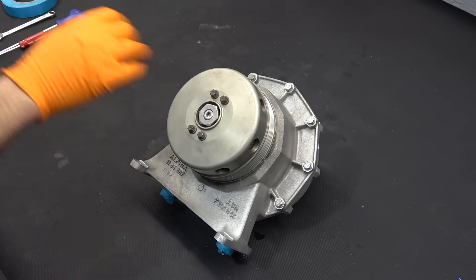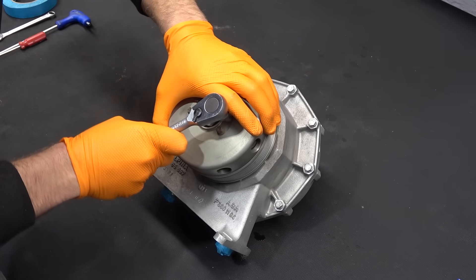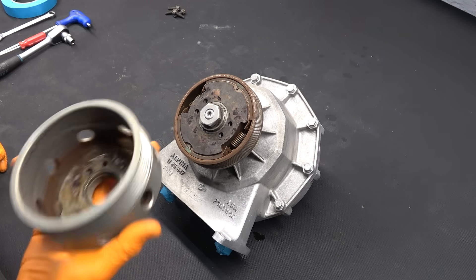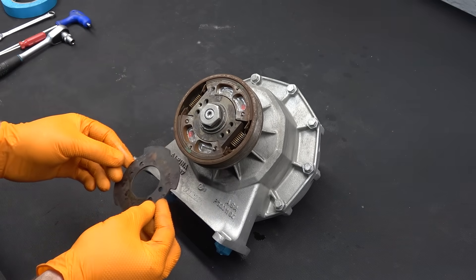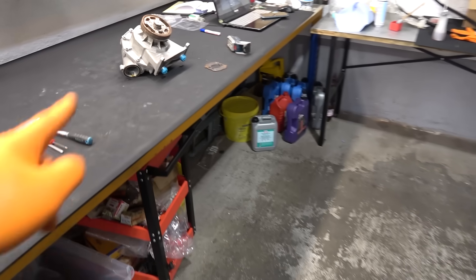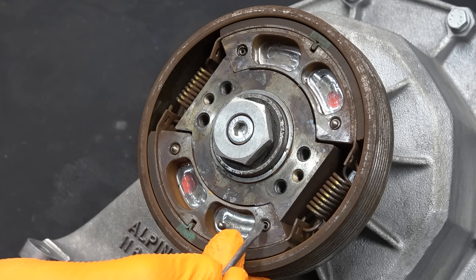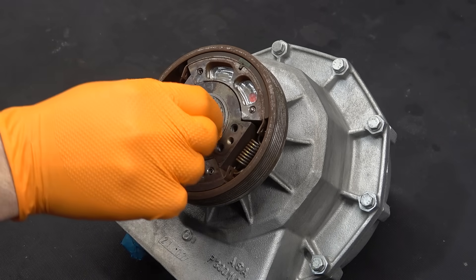The clutch assembly leaves behind this pulley, so we've got to remove that first. The clutch friction pads look good — smells like it but looks good. Remove the plate. There were balls in there — one just left the building! There are four balls with springs behind them, and on two of them the retaining clip snapped, which is why they fell out. I just need to be careful putting it all back together. Now I'm going to remove the bolt and the big spacer.